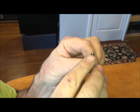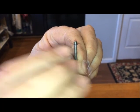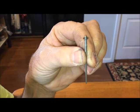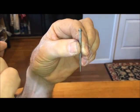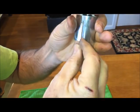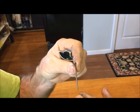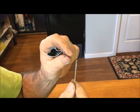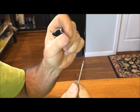When you take this clip off, do it down low with a really good pair of needle nose pliers. In case you drop it, you'll be able to find it — it'll be gone forever if it flings off into the dirt. When you raise this clip, the needle is now going to sit lower in the carburetor, lower into the main jet, so it's going to take longer and more throttle opening for this to lift up and let more fuel in. Just the opposite would be true — if you thought you were running too lean, pull the clip out, move it down, it raises the needle, and more gas flows through.